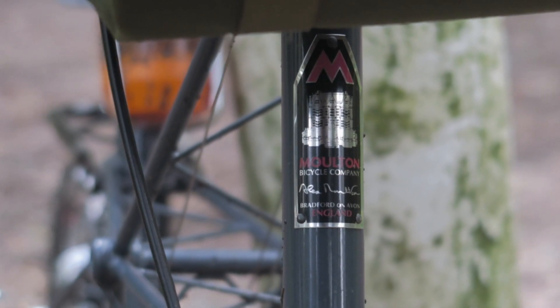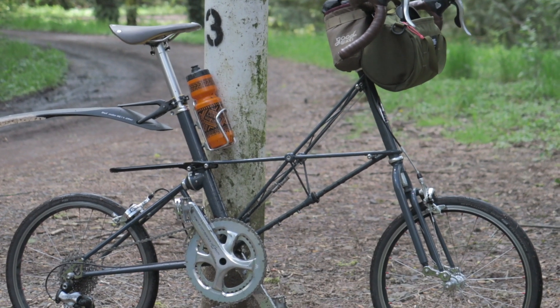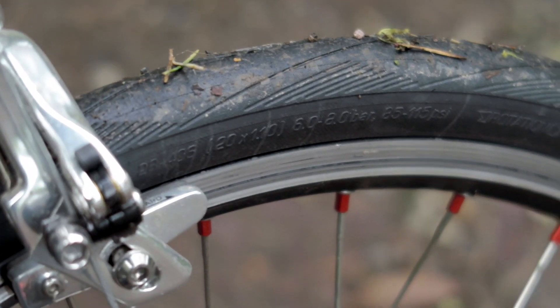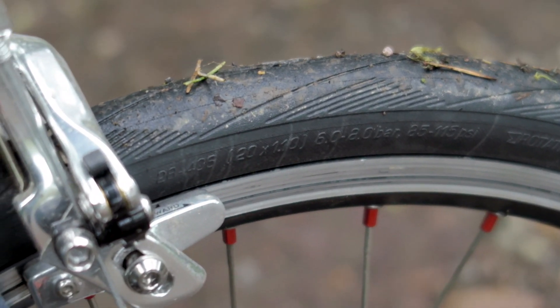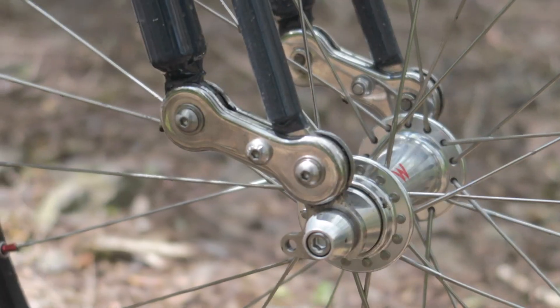In terms of going over this kind of not-too-rocky but definitely bumpy terrain, it actually does an amazing job — it feels way better than I thought it would. The active suspension on the frame is just doing a phenomenal job smoothing out the ride. Even though these are small 28 millimeter tires, it rides kind of like a 35 or 40 millimeter tire. The leading link suspension in the front and the linkage around the back just do such an amazing job. You do get the vibration and feel the bumps, but it is way, way smoother than you would think just looking at the bike.